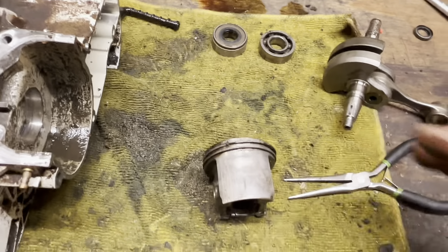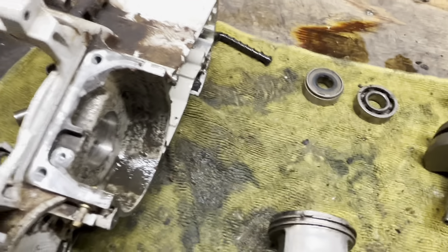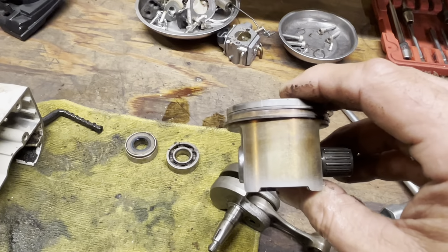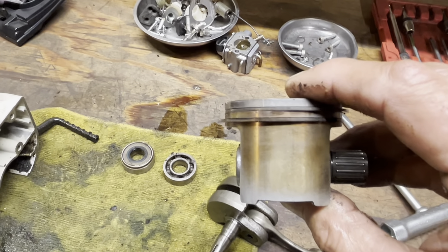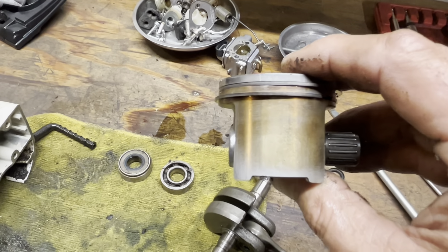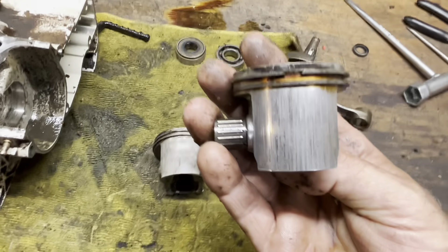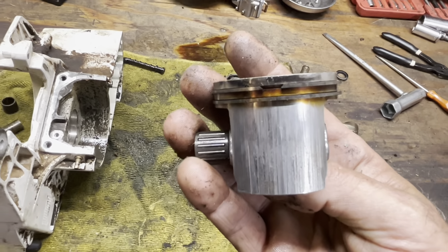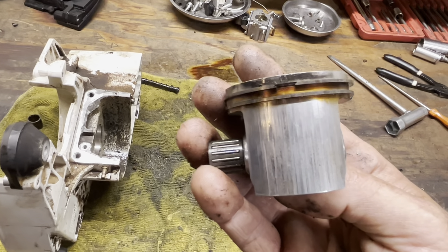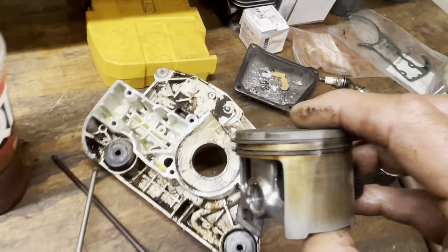This could also be a debris thing. Here was a sneaky one: I bought a 461 to rebuild and flip, and that was the picture of the exhaust side of the piston — I was like 'sweet, got a good top end on it.' Then I flip it around and you see all this. That's from debris getting past the air filter or being run without an air filter. Something bad wrong right there — this piston's trashed.